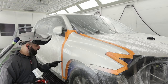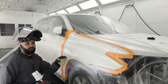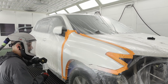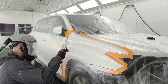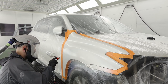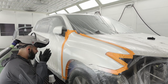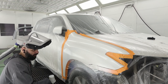I'm going to just go as far as I want to go — I can see where my edge is of just my white, so I just have to make sure I go that distance. Then my second coat is going to step in. I'm not going to do it wet on wet though. That's my first coat done. I'm going to grab my little blower, get this dehydrated, check it, and do my second coat stepping in, and then it'll just be the control coat. And that's it.